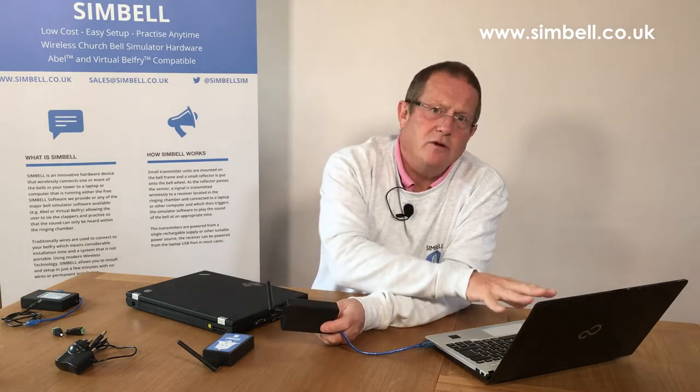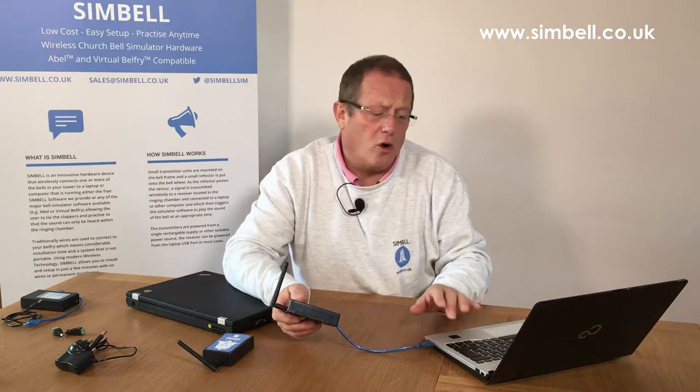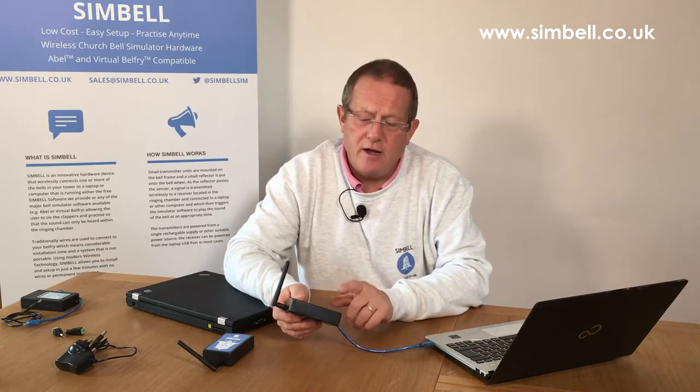If you're not seeing that flash of light, or you don't hear the noise, or you don't see the port appear under the Ports section in Device Manager, then potentially you've got a problem — either in the device, with the cable, with the socket itself, or with the USB connection within the laptop. The easy way to test is to plug the receiver into another device and see whether you get the noise of a connected USB device.